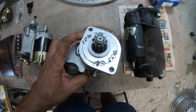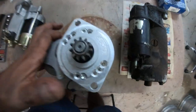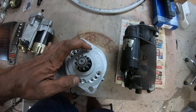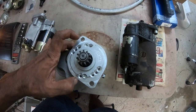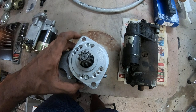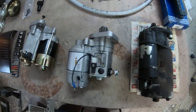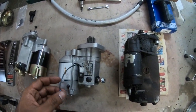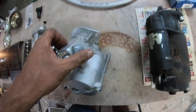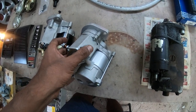On the 928 Motorsports starter, it's a nice unit. The cool thing is it has this machined aluminum flange that's adjustable so you can clock it. When I got it, the starter was oriented with the two bolts in the extreme holes, but when I mocked it up it actually fits better moved over a few degrees to the configuration you see right now - the second holes. The reason I did that is it gives me a little more room to fish the top bolt through into the bell housing, plus a little more clearance for these wires from the bottom of the oil pan.